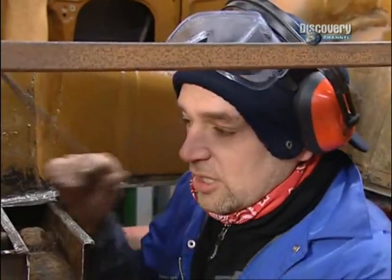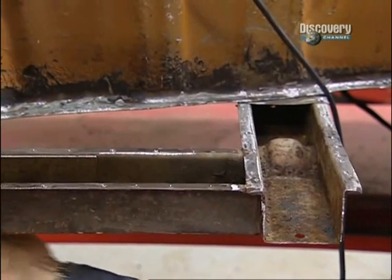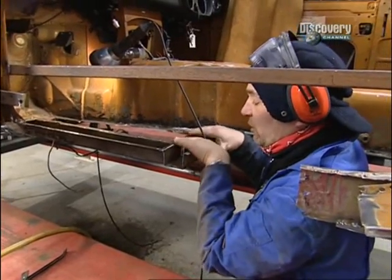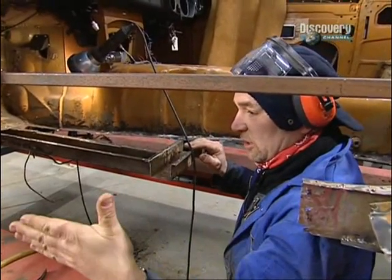This also shows here, now the floor's gone very nicely, this integral chassis within the monocoque, because this is the front chassis rail on this side and the floor sits on top of it, and this is part of the cross member. We've had to cut out the bit that goes out to the sills.